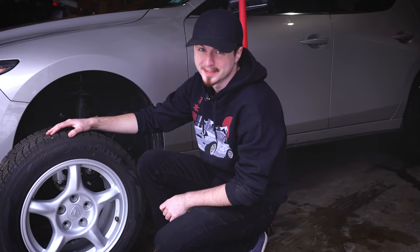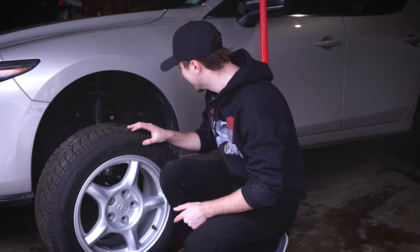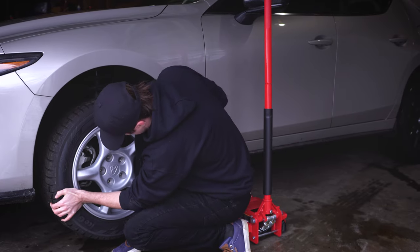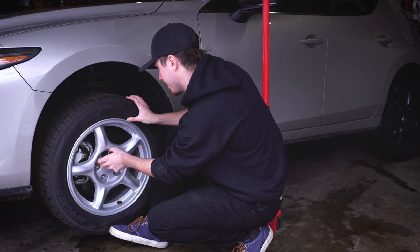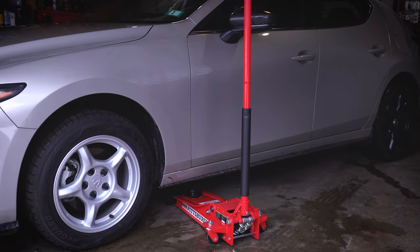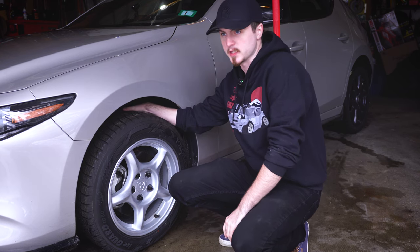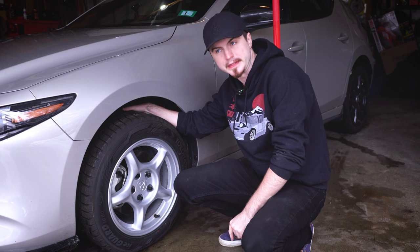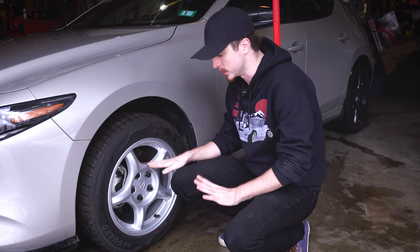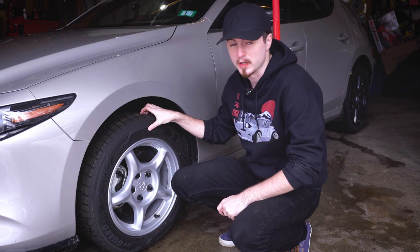The best part about this entire — get it, wintertime? — situation, is that I don't even know if this really fits. It should clear the brake calipers; everything checked out in the spec. So we're going to slap it on and see how she looks. With one of these on, the next thing you've got to check is the clearance between your tire wall and your suspension geometry. This is really, really close — probably closer than the factory setup — and this is a 16. We're jumping down from an 18, which is the factory black rim. However, the base model Mazda 3 does come with 16s, so theoretically everything should clear. The only way to tell is to take it for a drive and listen for scraping, which is horrifying, but...